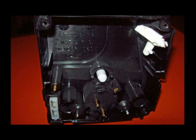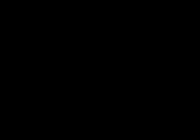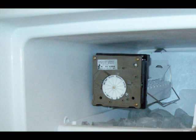So much for the older unit — I found no problems testing it; the problem was the freezer on that refrigerator. Now, why I made this video: I just couldn't find enough information online to do what I needed to do. My ice maker on my Kenmore quit working completely — it's probably 10 to 15 years old and had never given trouble until now. I removed the plastic cover on the end of the timer — it just pulls right off. To remove the unit, loosen the three quarter-inch screws, let it hang down, then disconnect the wiring connector. Before removing the ice maker, you may want to run some tests with your multimeter; the leads go through the appropriate holes shown later in this video.